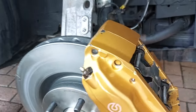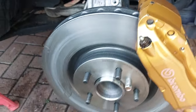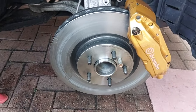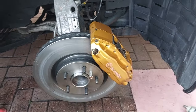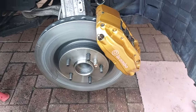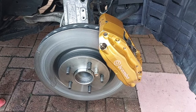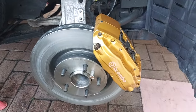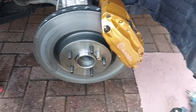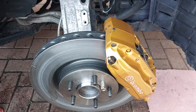Got everything back together - that little pain with the slider is all dealt with now. Just gave the brakes another quick bleed, gave the disc a last clean, wheel back on, and onto the other side. I'm not going to bother filming the other side but you've seen the whole process now. Hopefully you found that of some use for future reference or if any problems come across. I'm really doing it to document this for myself and maybe any future owners of the car. Thanks for watching, I'll see you again soon.